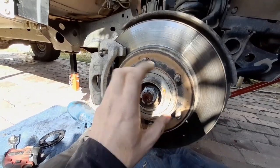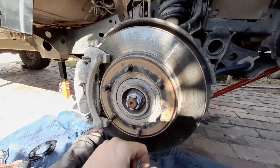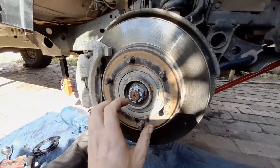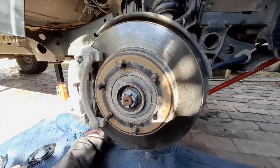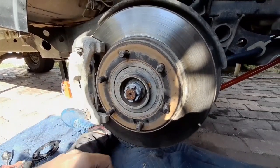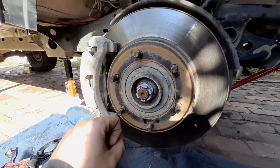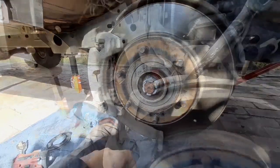What I should have said was: before you jack the car up and take the wheel off, undo that CV nut first. It's a pain once it's up in the air because there's nothing to stop it turning — I had to put a crowbar in there and it wasn't fun. This side was actually pretty tight whereas the other one wasn't, so yeah, undo that before you jack it up — it'll make your life a lot easier.